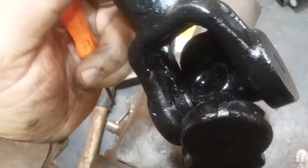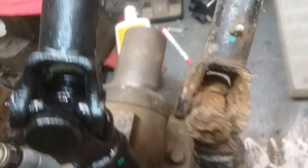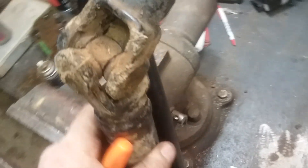These not being sealed up — I don't understand what their goal is with that. At least I can say the drive shafts now are in phase. When you look down them, the yokes are lined up so that you don't have a drivetrain wobble or vibration like they had in some of the earlier models.